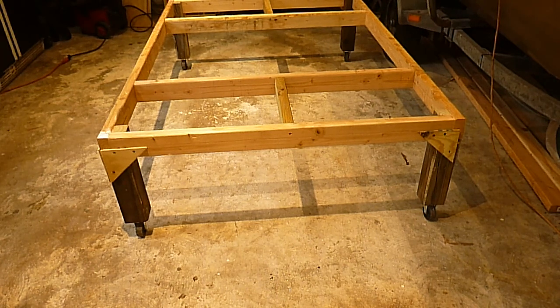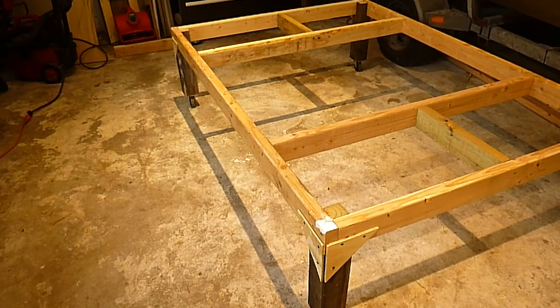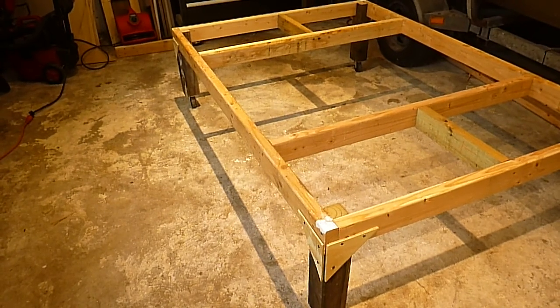This one's going to be five feet wide. I put my cradle back together — I still had the parts from the first cradle, which is what you're looking at now. I did shorten it a little bit, making it only six feet long so the ends of the teardrop will hang off each end and I can get at them easier. It's still four feet wide, and the new teardrop will hang over each side by six inches, so the sidewalls run from the bottom up into the walls without needing to lift or scoot it.